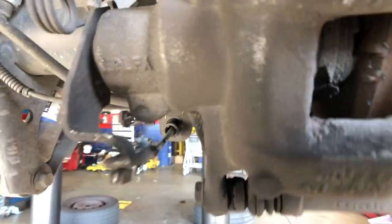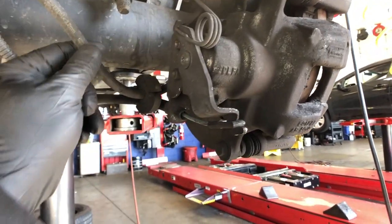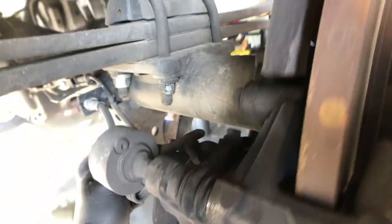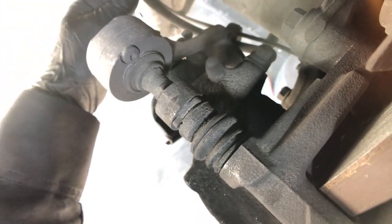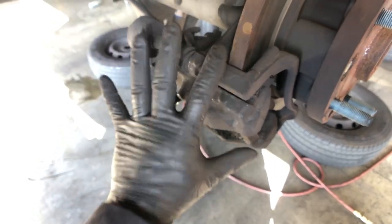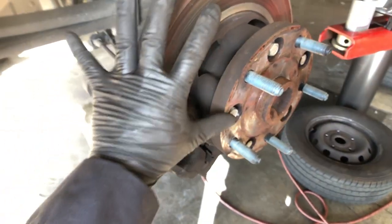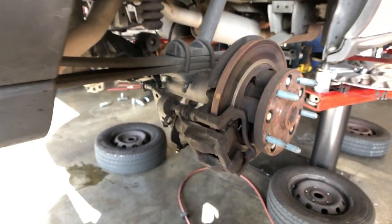It's not a big deal on this caliper - there's only a parking brake cable that we got to remove and the hydraulic brake line, which I believe is a 12 millimeter or a 10 millimeter. We'll take off that bolt, pinch the line so it doesn't leak, remove the cable, take off the caliper, then the bracket, the brake pads, and the rotors. We'll remove all of it - got to take off the axle too.